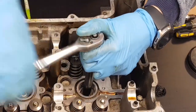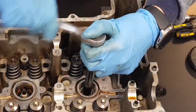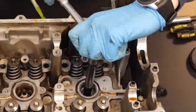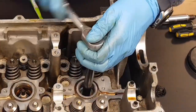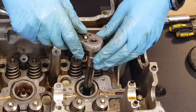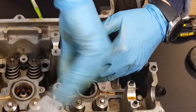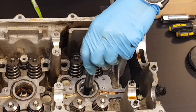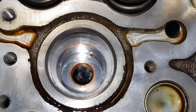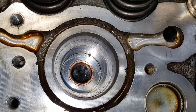I'll carry on until it's pushed all the way in and then it'll become looser. That's now gone loose, so the insert is installed and I can remove the insertion tool. You can now see the finished insert, which sits just below the surface of the head — that's ready for the spark plug to go back in.